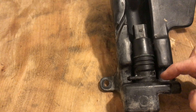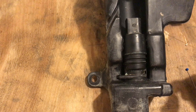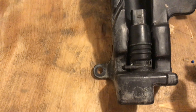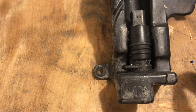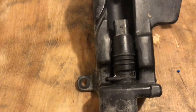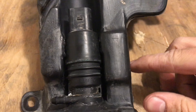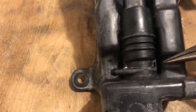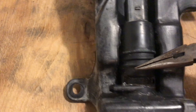There's a little rubber gasket at the bottom with a little filter on that. I actually pulled that off on mine and replaced it several times. I cleaned both surfaces and it still leaks. And I think the issue I've discovered is these little holes right here — they actually go to both sides, through the pump on either side.